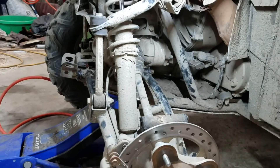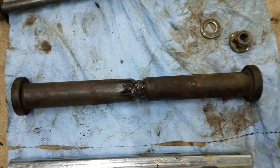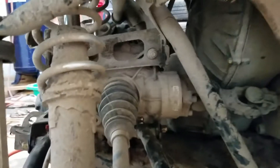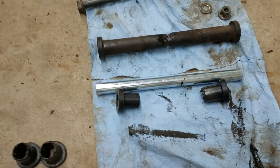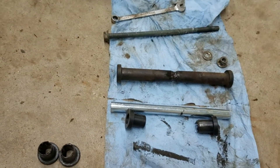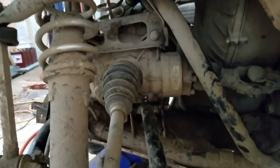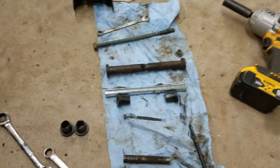One side is almost completed. I'm having a bit of a dilemma here — the stock bushing has way more coverage than the new ones. It didn't have any play that I recall. I know the new ones are supposed to be better material, so I'll put the new one in since I'm replacing all of them. But I am saving all the old ones just in case. Skeptical — hopefully it's fine, but more material coverage matters to me.